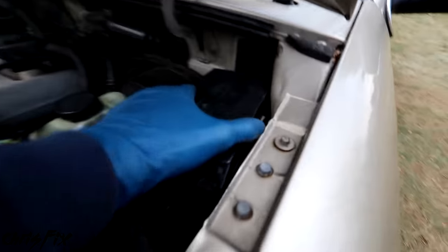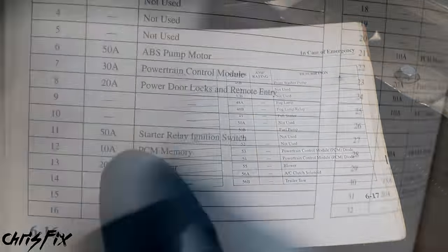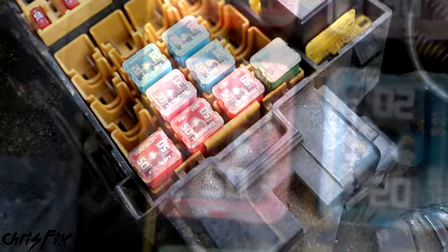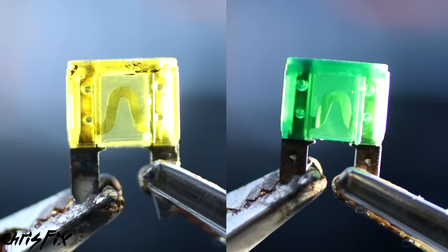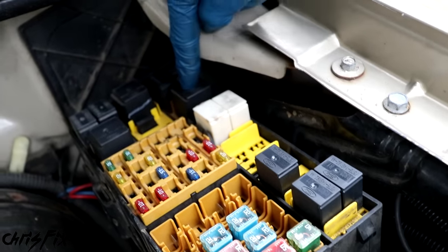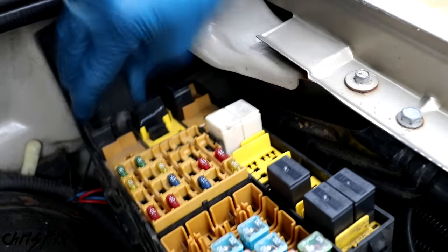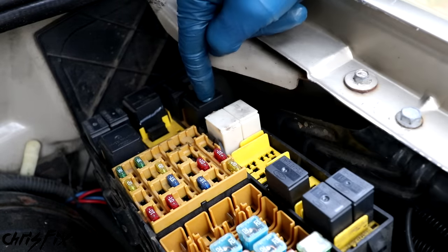The last thing to check before replacing your starter are the fuses and relays. If you aren't sure where your fuse box is, check your owner's manual - it'll give you a diagram showing exactly where the fuse is for the starter relay. First, check that starter relay fuse and make sure it's not blown - just make sure the connection is not broken. Now we're going to check the starter relay. Have somebody start the car and with your finger on the relay, you should feel and also hear a click. This clicking usually means the relay is working, but to be sure you could remove it and swap it out with another one. With both relays in, we could try starting the truck. I can hear the click but the starter isn't engaging, so we know the relay is good.